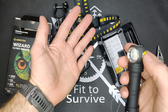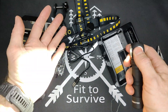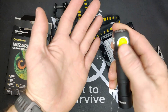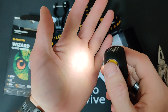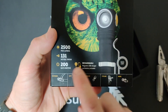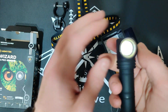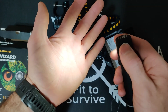Double clicking takes it back to your normal settings. If you click it four times, you get your strobe. If you hold that down, you go to your SOS. If you click and hold while it's off, it goes into moonlight mode — very dim, you can barely see it under overhead light. It's about 0.1 lumens, and on this setting it can last up to 200 days. They actually have a couple of moonlight levels; this is the dimmest. It's cool that it has that option. There are actually three different moonlight levels. Double click and it goes back to our standard brightnesses.